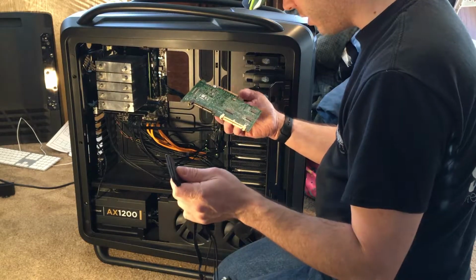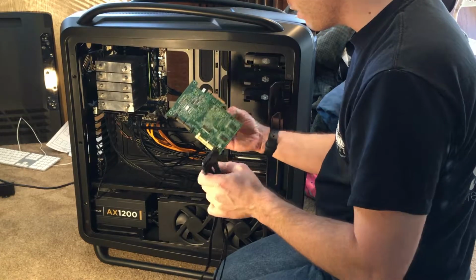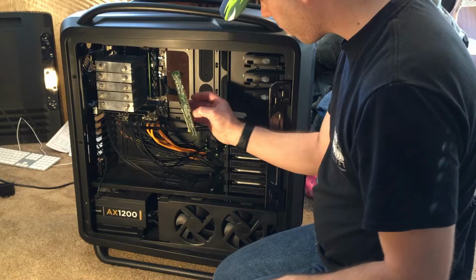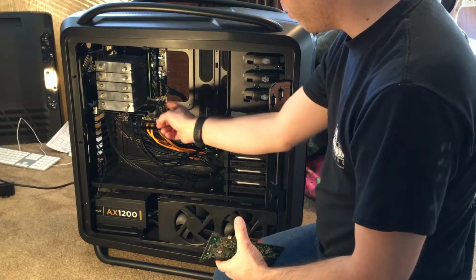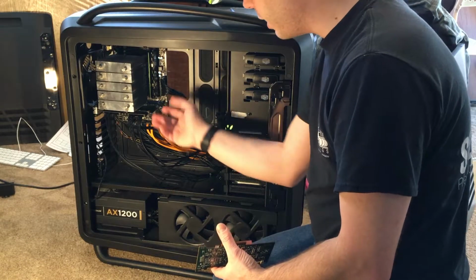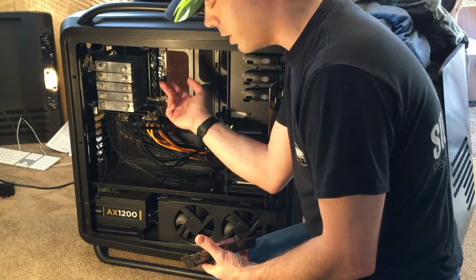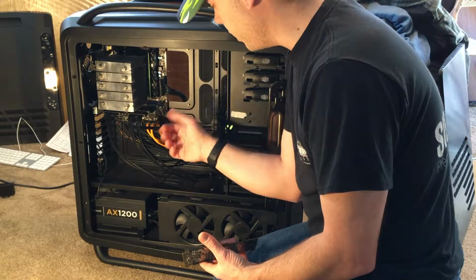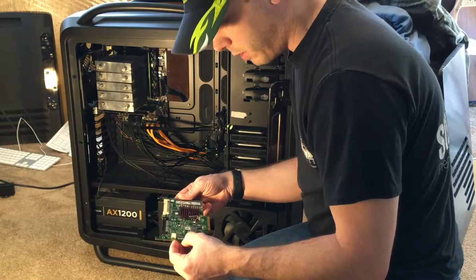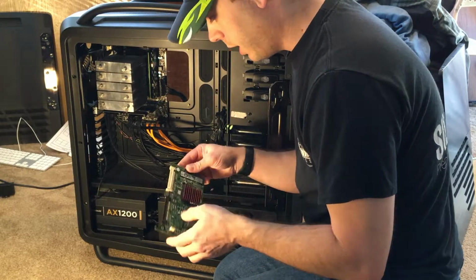As I understand it, they have to be SATA 2, not SATA 1 drives, and they can't be more than 2 terabytes with these particular controllers. That one is good because you can flash the standard LSI firmware onto it, and it becomes a standard hard drive controller. It takes the RAID part out of it and lets the software RAID in FreeNAS take over, the ZFS, which sounds kind of neat.